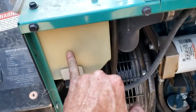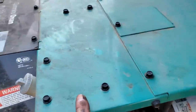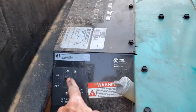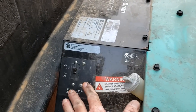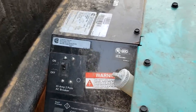You have the engine oil dipstick for the generator, engine oil fill, and your engine coolant reservoir. It's easier to see on this side. Right behind that coolant tank is where the air filter is located if you need to replace it. The last important thing to know about is that 110 circuit breaker. If you're running the generator and never get any power inside, or you suddenly lose power, turn it to the opposite position and back on to reset it and hopefully restore power.